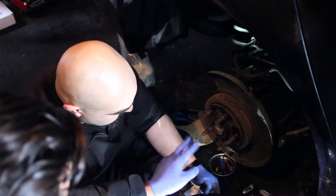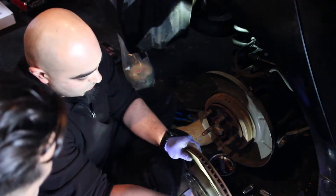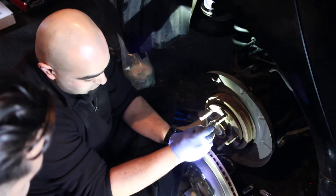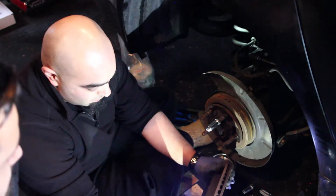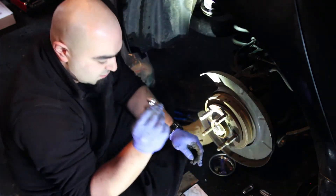It's also good practice to have your lug nuts on there so when you're hitting it, it doesn't fly out. So when you have the old rotor back on there before you start doing this, just put two nuts on it so when you're hammering it out, it doesn't smack you in the face or anything of that nature. It's just a safe practice to do — do as I say, not as we do.